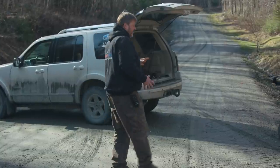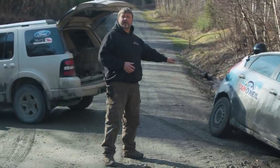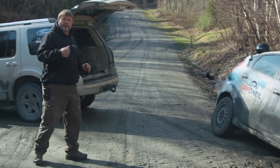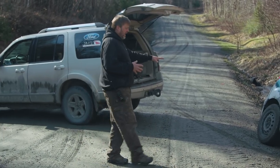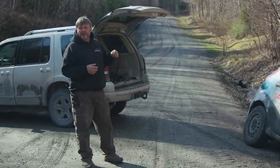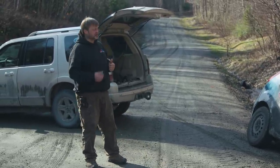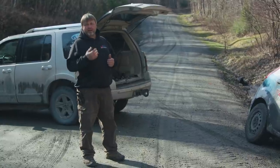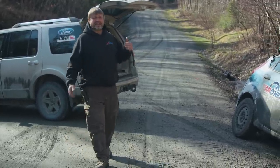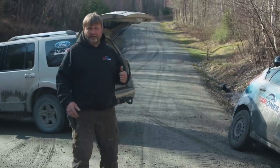The back end of this front-wheel drive car is very light, so it's going to slide nice and easily. I'm going to pull them at a 30 to 45 degree angle. Once the back end starts moving, that'll start to pull the front end up onto the road. I start the back end of the car moving first and then the front end is going to follow, and most of the vehicle will be up on the road at that point. I'm going to rely on kinetic energy to pull them up on the road rather than traction.